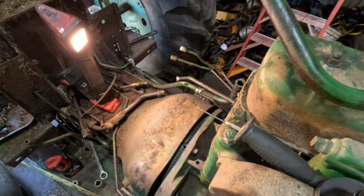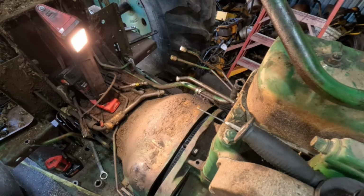I had a pipe wrench handy, but I got another one here. Yeah, so did I. Here's another one. Got it? Yep. Because it should be turning. Is it turning? Be really slow. Is it turning? No. Then we're not in there all the way yet. Do you want me to move it a little bit? Yeah, go ahead. Oh yeah, I can turn it by hand. Okay, it's not in the splines then.